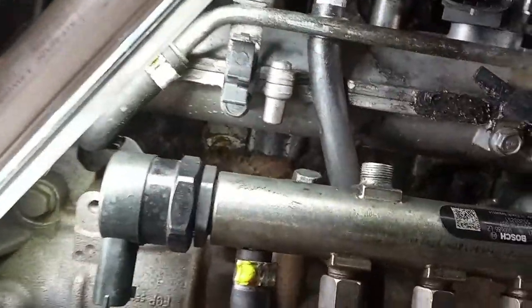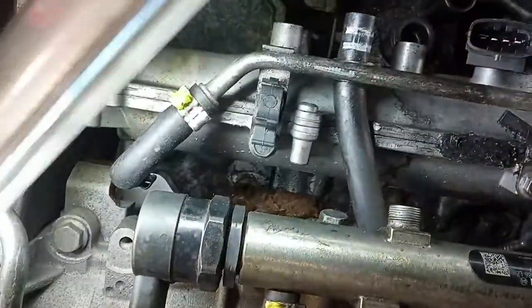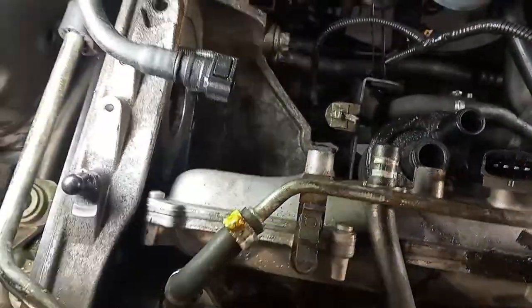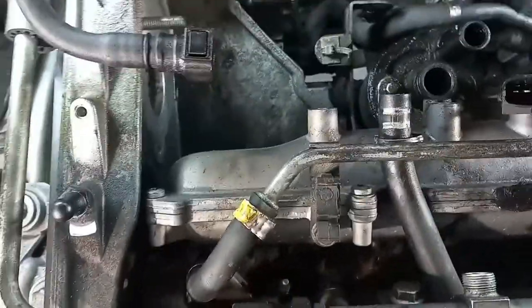The swirl on this one is already deleted, so I would not do a video for that, but I will have a video for a swirl delete soon on my channel because I have a GT to do also, and on that one I may have to take out the bracket, or the support, for the high pressure fuel pump, because that one is a different type. But on this one I'm glad it is like this, so I can show you that it is possible.